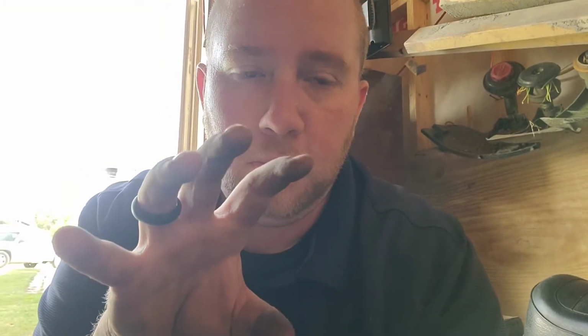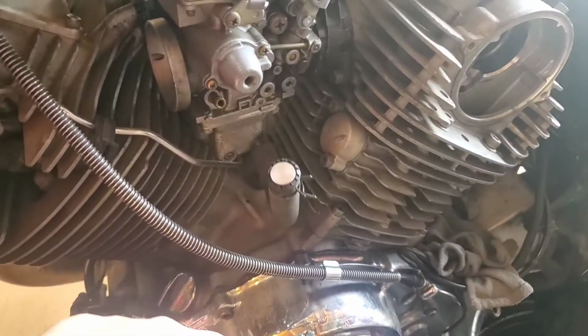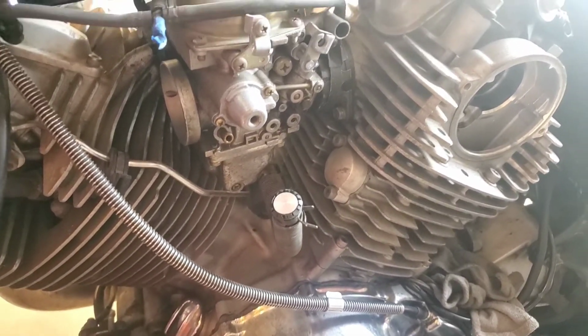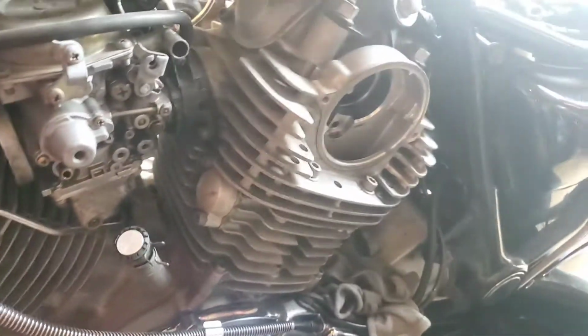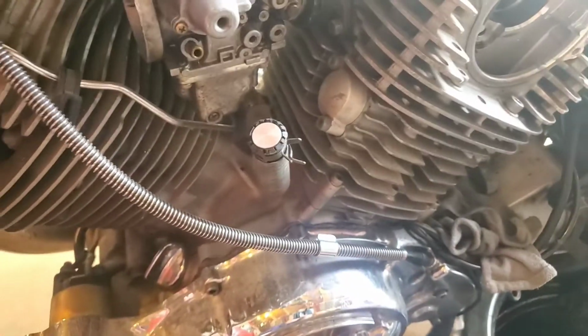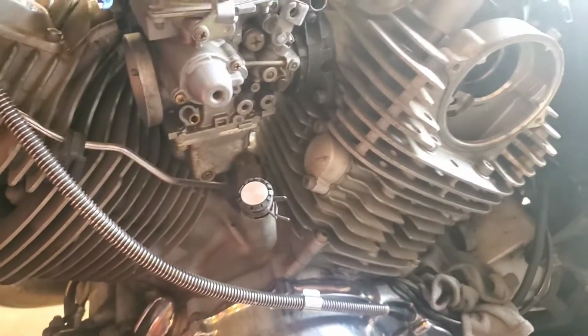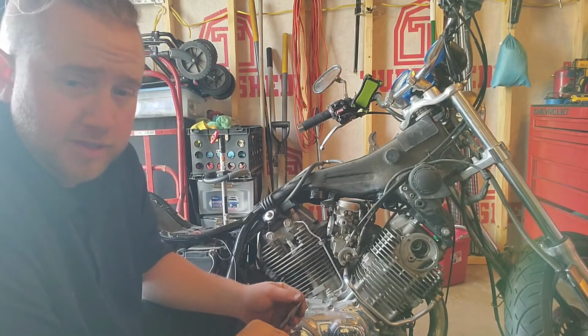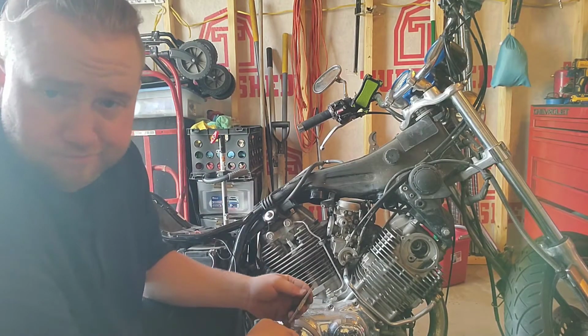So those are supposed to go to the back of the AIS pump housing, which looks like the little bug eye air box that's on the right side. But I did a thing. I found these. There's some kind of a plug, could be an AIS plug for a V-Star 1100. Don't know where I had it, but it's just a little billet style plug. Put them in them hoses. Ganked the whole rest of that system out of there. I wasn't having it. She was already doing all kinds of cool backfiring and spitting and stuff, so I just went ahead and said, no, I don't need that.